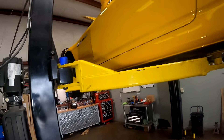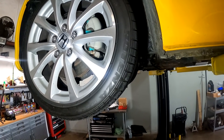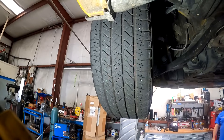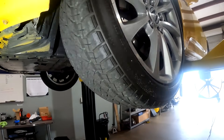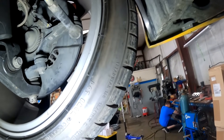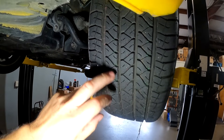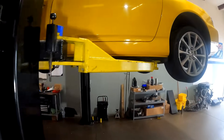The rear isn't as bad as the front. The most bizarre thing - George and I were joking about this - is the tire. We've seen a lot of tires but not this one: the Bridgestone Potenza RE92. Look at the tread - the general shape and pattern just looks like a regular Toyota Camry tire that'll go 60,000 miles without a problem because it's hard as a rock. The temperature, traction, and tread wear rating is 160, but it looks like a 500 or 600 tread wear tire. You cannot dig your nail into that rubber at all.